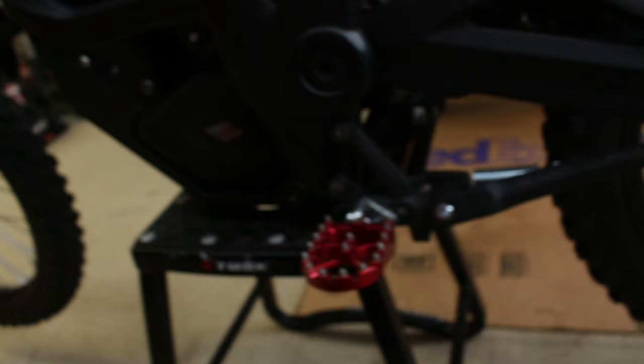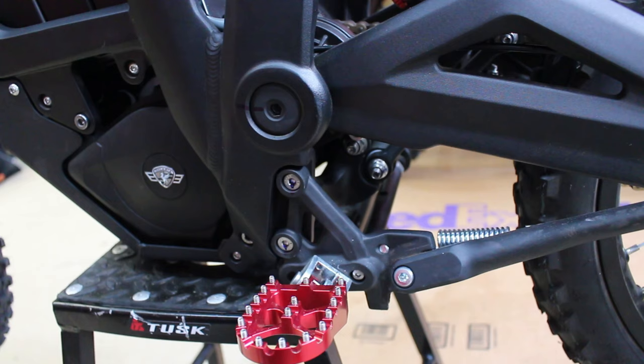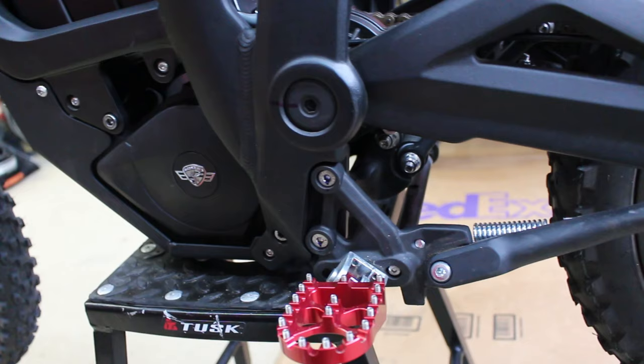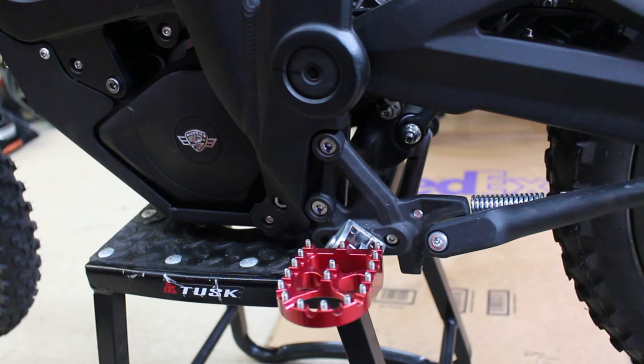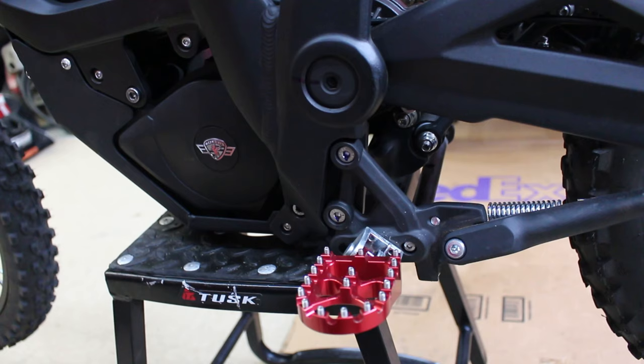From talking with Eric from Luna Cycle about these differentials, he informed me that Talaria has never seen a differential fail. On some MX3s they had a problem where if the chain derailed it would snap off, but they've fixed that with a beefier bracket this year. He said they're looking into testing how much longer they can go between oil change intervals, and they're also going to test running that gearbox as long as they can with no oil at all. It seems Talaria was playing it safe with the MX3 recommendations.